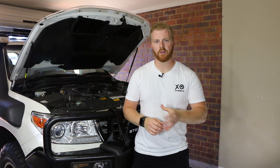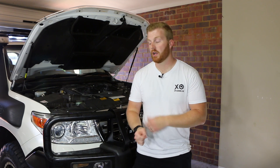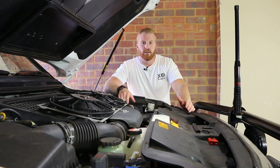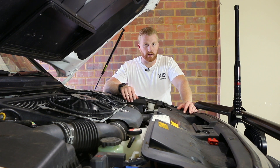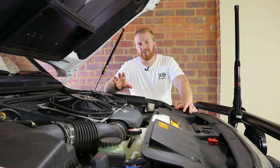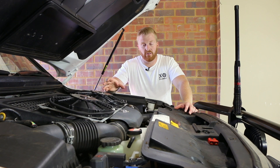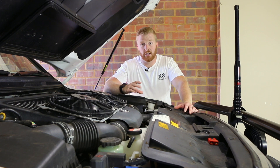We do know that reduced charged air intake temperatures provide a benefit — in top-end drag races, dry ice is sometimes used to cool the intercooler immediately prior to a race, and data shows these fans can produce a benefit on dyno runs. So if you're planning on drag racing a 200 series or doing multiple dyno runs or hard acceleration tests, these fans might provide the edge you need. There is one more scenario where these fans might provide a benefit — towing a heavy load while executing difficult terrain, like a heavy caravan up a prolonged hill. My prediction is the fans will provide a benefit at really low speeds; however, with any reasonable airflow, this intercooler is very efficient at cooling. This is something I'll endeavor to test in the next few months and will make a video about.